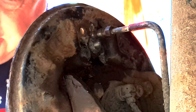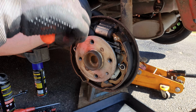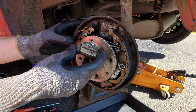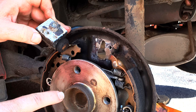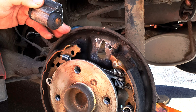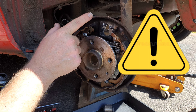Don't lose the screw — can't guarantee that the new one comes with one. If you're really lucky the cylinder may come loose, but chances are you'll need to give it a little knock, perhaps with the back end of a screwdriver, just to loosen it off and very carefully withdraw it. The shoes should stay exactly in place because the self-adjuster holds them apart against the springs. You can actually see a little white corrosion of the Mazak casting that forms the main housing of the cylinder, so I'm going to clean this up with a wire brush and then put a very light smear of silicone grease on there before putting the new one on.